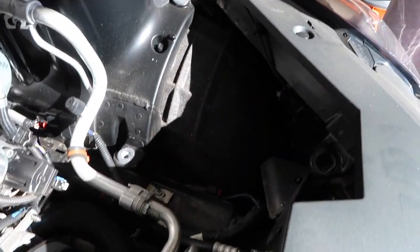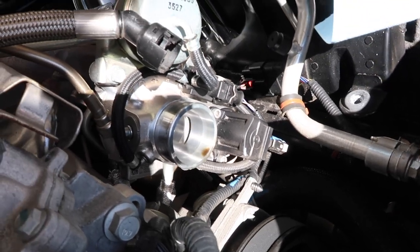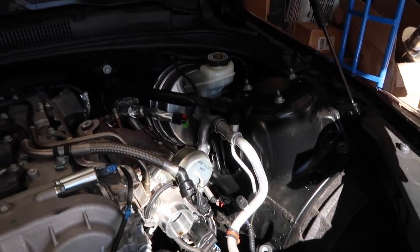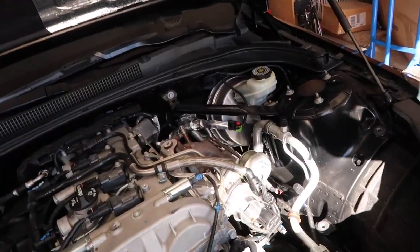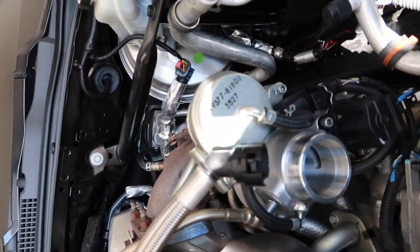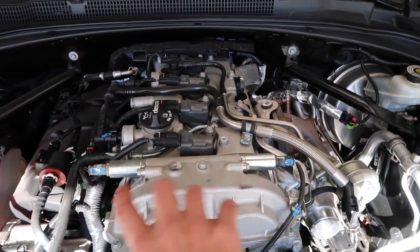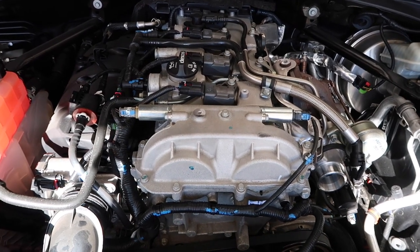After you have that tube removed, you're going to go ahead and simply tug on this — there are like three grommets and it should come right out. Put that to the side. You're actually going to have to reuse this MAF, so make sure not to throw that away. Also, you have to reuse these grommets right here — there's one, two, and then there's one missing. Make sure you go back to your stock airbox and remove the grommet located right here. I also noticed there's a little bit of oil inside the intake — I'm not sure what causes that. I don't know if it's blow-by — I'm not really experienced with turbo motors so I've got to start researching.